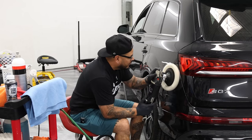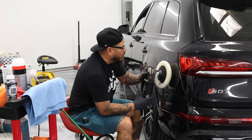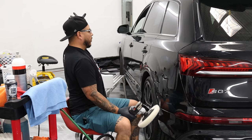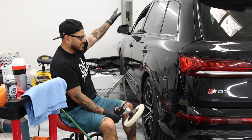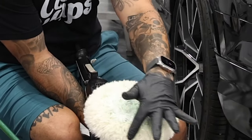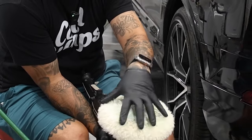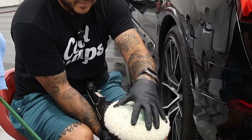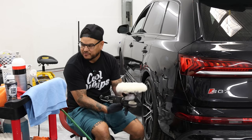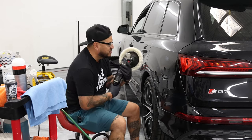So again — flat, turn it up a little bit, crank it on there. You notice right when I did that, I didn't shoot compound all over the place — it all stayed on my pad. Look at that, look at the trace. It's evenly distributed, it's on the machine. It's going to naturally get into those fibers. If you want, you can blow it out and add a spritz of water, but this is just straight on.